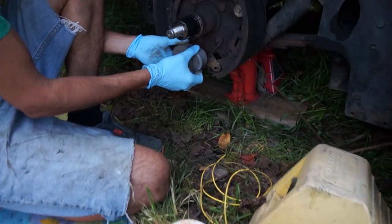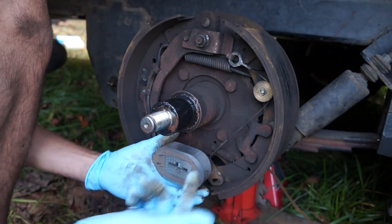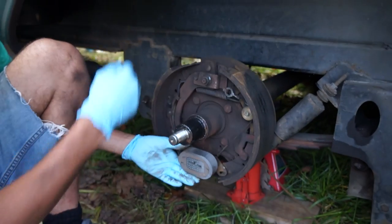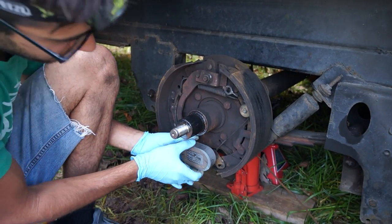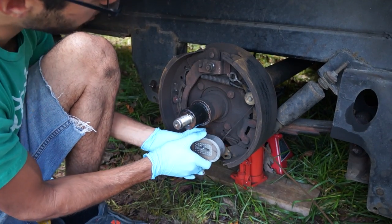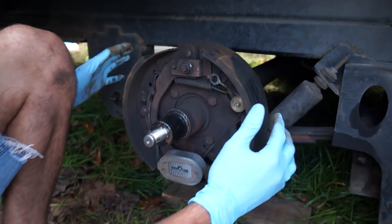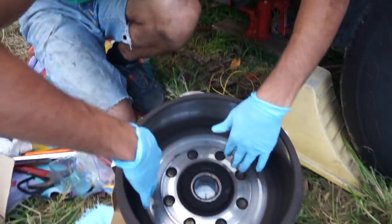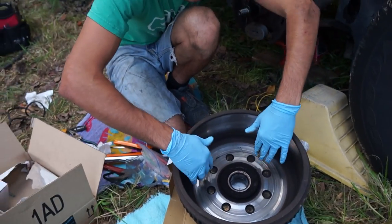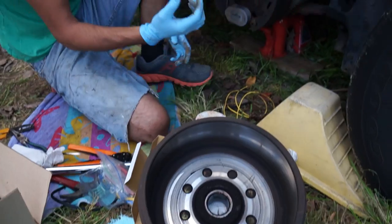When the wheel is spinning and rotating in the forward direction, the magnet sticks to that outer armature and gets dragged along that surface. You can see what happens: it presses out on this brake shoe and squeezes the brake shoes against the outer drum — right here — this is the drum surface that the actual brake linings push against and wear down.